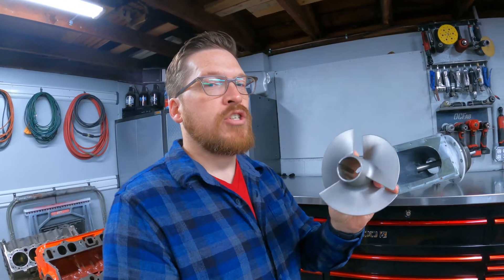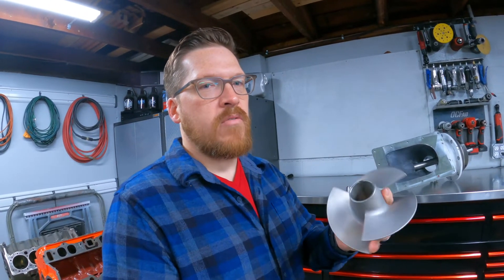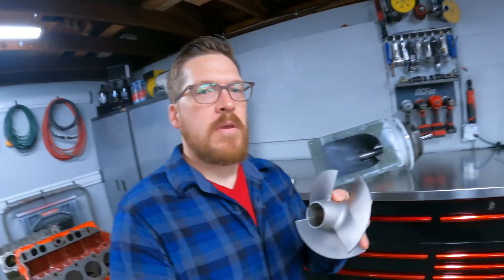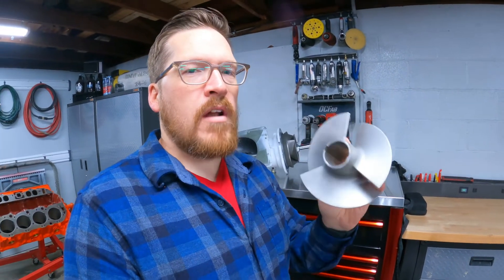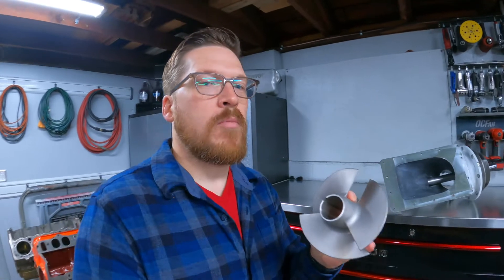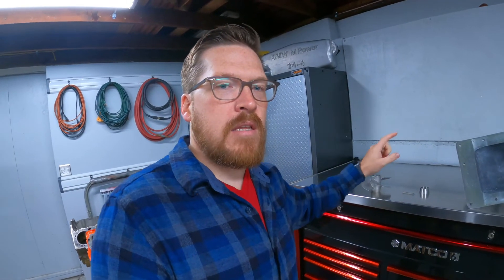There's really no downside to these other than the expense of installing them. You have the expense of the part itself and then the added expense of having your shaft machined, and that all adds up to several hundred dollars. An inducer is kind of a modification you'll do when you're towards the end of the path of easy modifications, or if you're really looking to refine or perfect your setup. I'm going to go ahead and get this shaft out and show you where it needs to be machined.